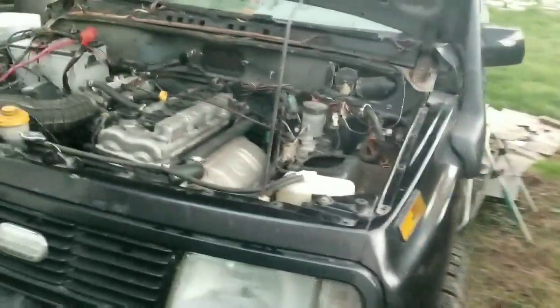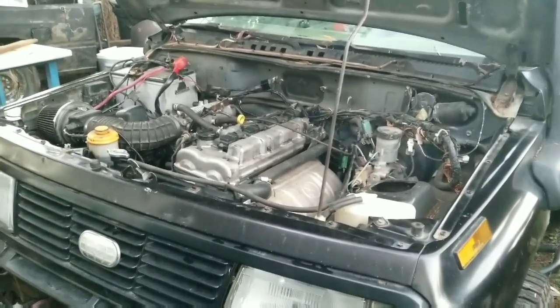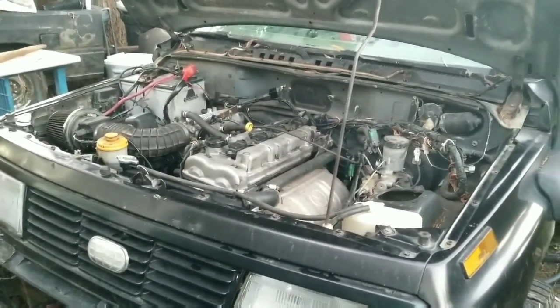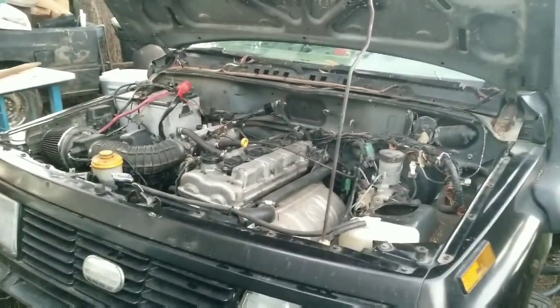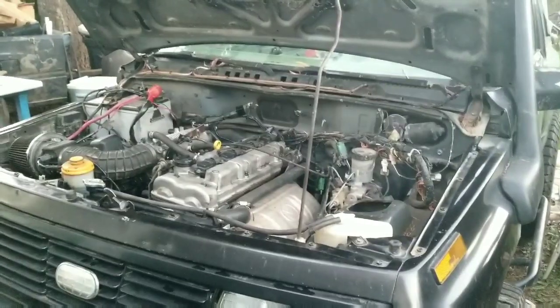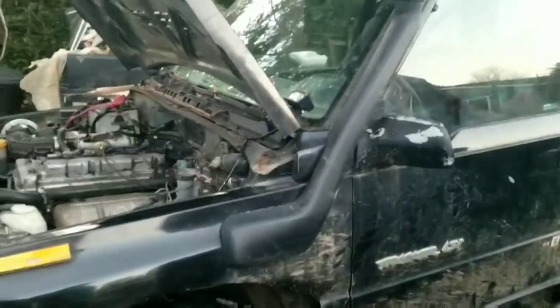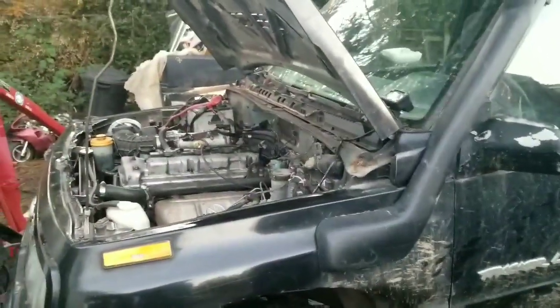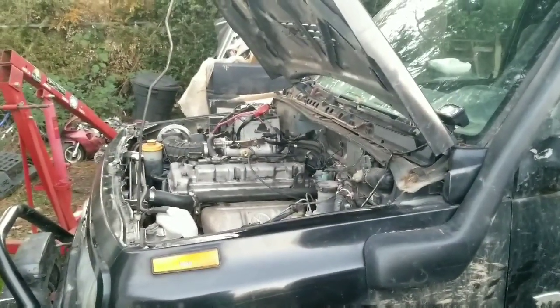My theory, though, is that the motor sat, and by me firing it back up again, perhaps damaged the head gasket because it had dried out or something like that. That's what I'm going with. It is possible, and that's what we're shooting for, because the oil in it when I drained it was in good shape. So I'm thinking it got messed up upon lighting, and thus the heads are not warped.